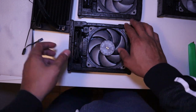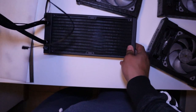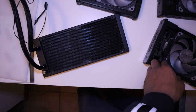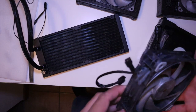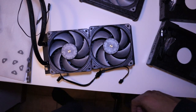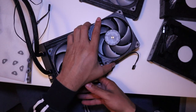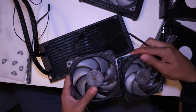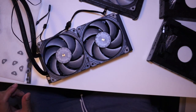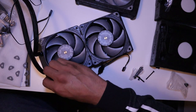Both the fan blades and the fan frame are made from the absolute best glass fiber reinforced liquid crystal polymer material. This makes the blades and frame extremely rigid and durable. And the T30 is designed with exceptional aerodynamic features, which requires high precision manufacturing. The liquid crystal polymer enables this thanks to its great material properties. The tip of the fan blade has a continuous and small clearance of only 0.5 millimeters. This reduces turbulence and delivers unparalleled noise normalized performance.